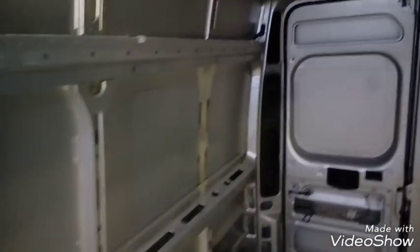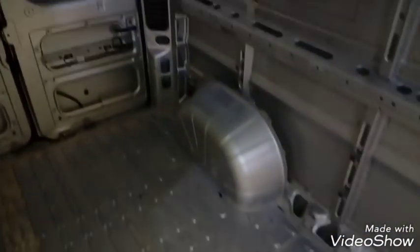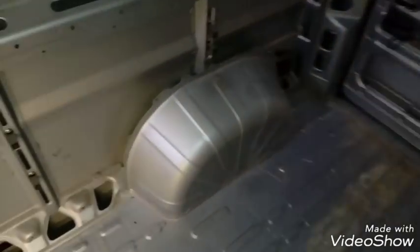There's one in the sliding door as well. I've marked where the lights are going. So basically what I'm going to do now is cut these windows out, get all the metal protected and let that dry. I'm going to put some framework around the windows as well, get these wheel arches cleaned up, get some panel wipe on to make sure there's no grease on them, and get them carpeted — same around the door edges and down here as well.